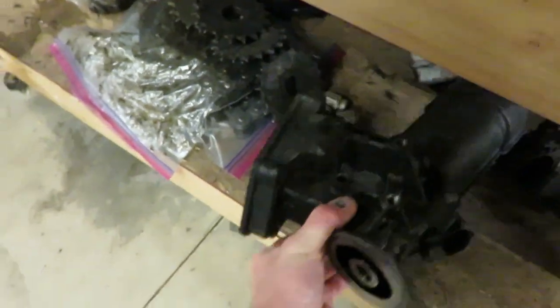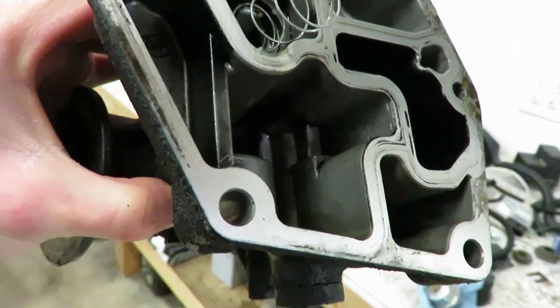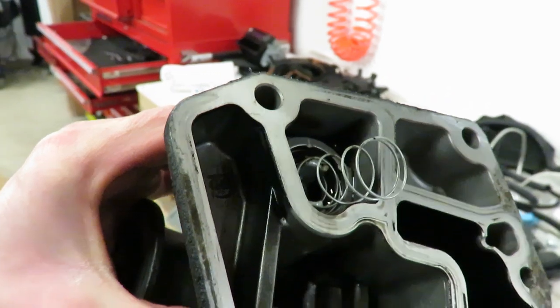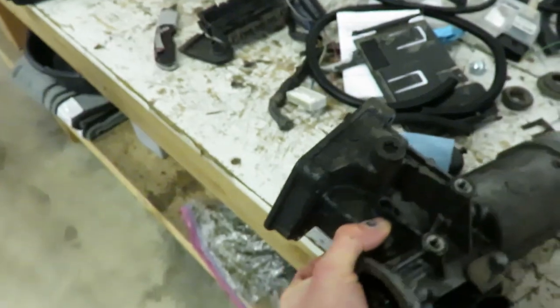I'm thinking it's something to do with that pressure relief valve. The stock housing has a pressure relief valve — actually has two of them. One opens at like 160 psi, which is to save the motor on a catastrophic blockage, and one regulates the pressure and opens at like 60 psi. Obviously with that plate, we don't have one. So I think that's what's causing all my leaks — it's just way too high of pressure, and it's literally leaking out of everything, even my oil filter's leaking.